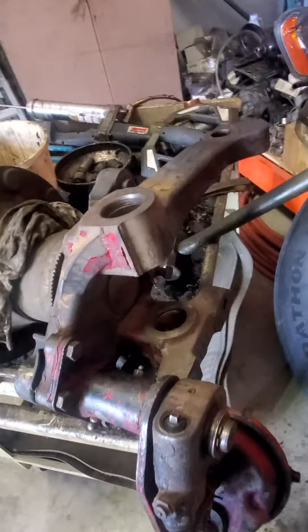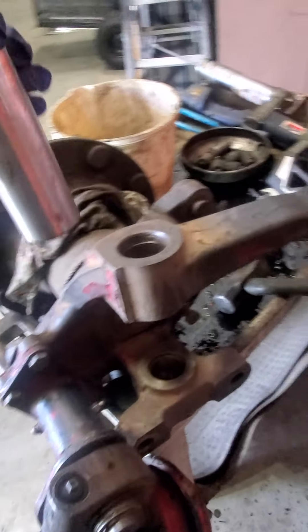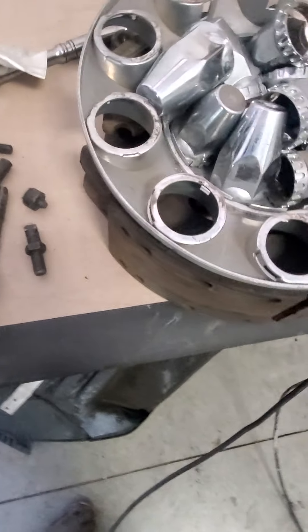What I did was I actually started the kingpin. I don't know if I'm going outside the box here, but this is the bottom of the assembly. I actually started it and got it down because there's the bearing. Here, I'll show you on the other side. This is the bearing that has to go in. That ridge on the bottom, that's exactly how it sits. As you can see right there, it's got to sit like that.